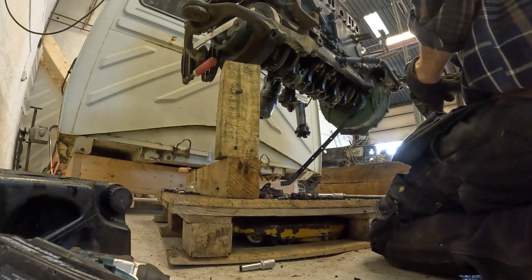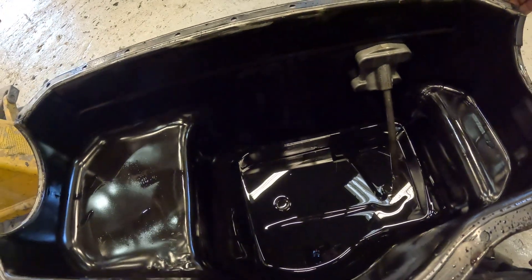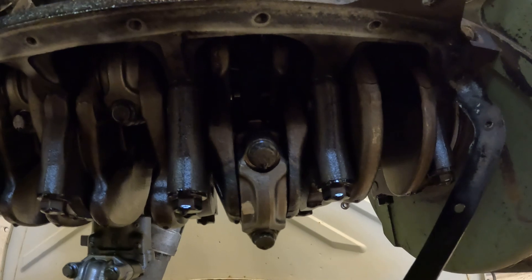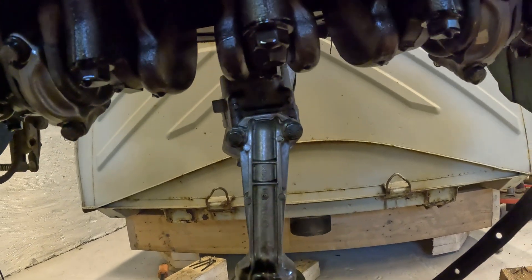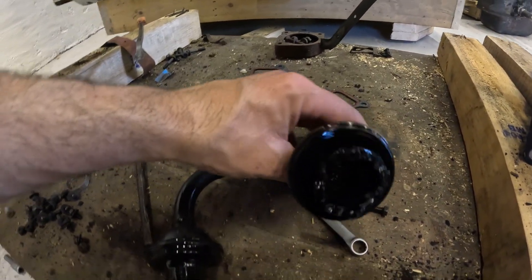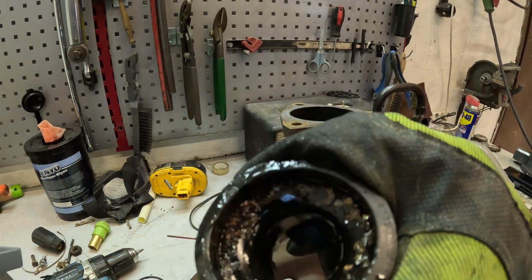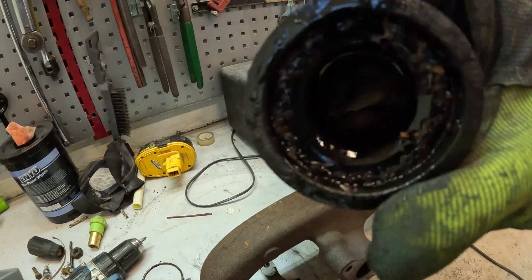That's really nice - there's no engine parts in the oil pan. Check it out. The oil pump pickup looks exactly the same - same plastic rubber piece there. The contact face is a little bit smaller, but looks right. This is the oil pickup, and it's full of metal flakes. I guess I found my bearing - or bearings.